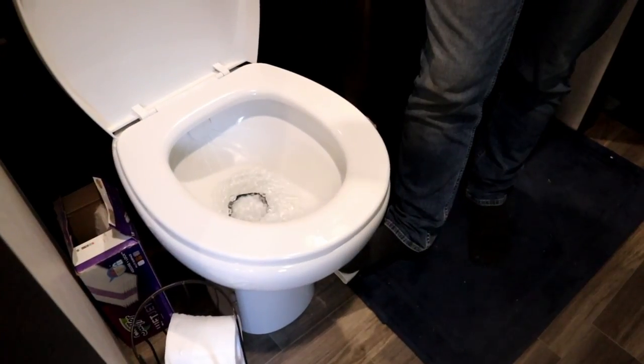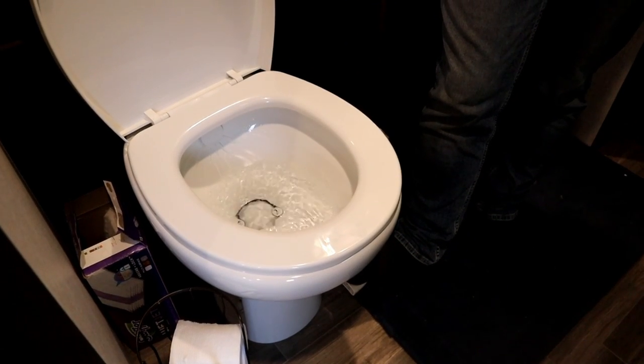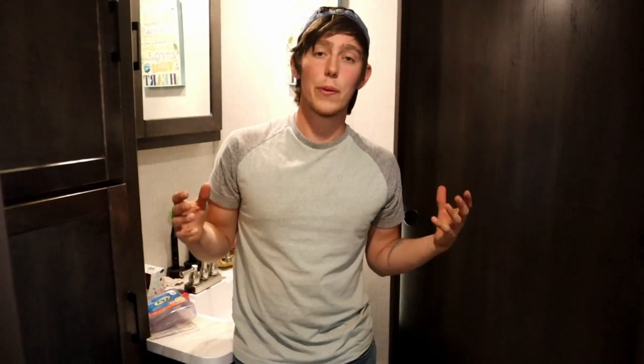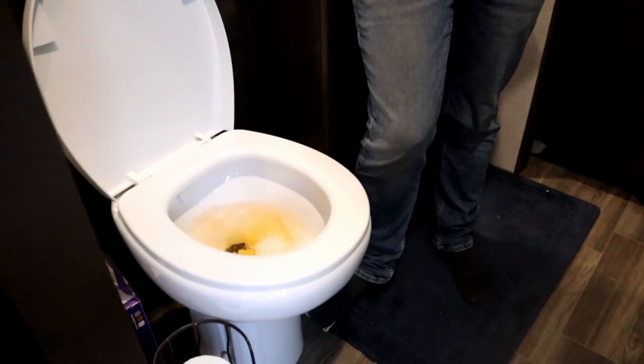If you just got your toilet or you've just dumped your black tank, you want to prime the black tank so it's ready to accept waste. To do that, halfway press the pedal and fill up about one toilet bowl — roughly two gallons of water — so there's a little bit of water in your black tank. Once your toilet bowl is mostly filled, put some RV toilet treatment in. This will help break up waste in the black tank so it doesn't get stuck together. If a pyramid forms — look up what that is — your black tank can become impossible to drain. Pour a little of the treatment into the water, then flush it down, and now your black tank is primed and ready to go.